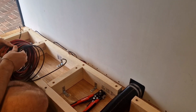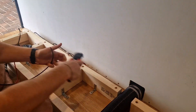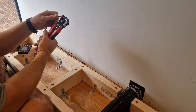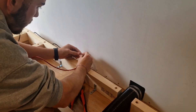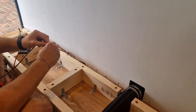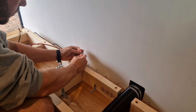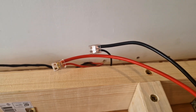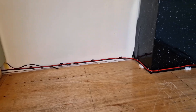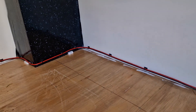Fast forward a few months — it was time to wire in our diesel heater. We've got an under-mounted diesel heater running up through the floor, and you can see the duct running underneath the frame of our kitchen. It was as simple as connecting the 6mm cable to the diesel heater cables through some two-way Wago connectors, then neatly running the cables through the van to where our fuse box is, where they'll eventually be fused and connected to the rest of our system.